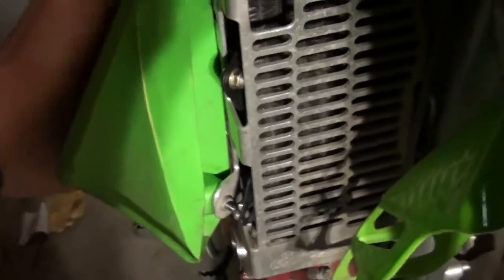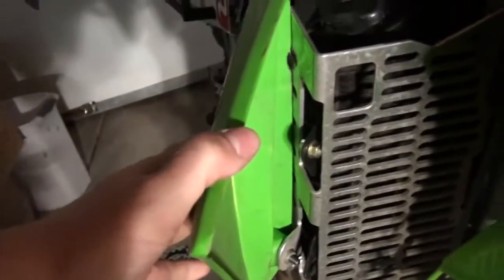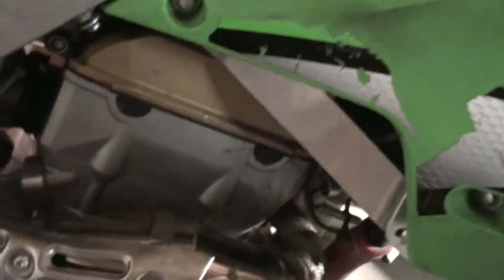You can see that it mounts directly into the shroud, or replaces the bolt that would normally be right here. They do take a bit of work to get the radiators on because you have to move the ground cable that would go on the radiator. But they fit nice — very solid units. They do prevent any shifting and any potential damage you might have to your radiator, making it very unlikely that rocks will go and bend up the radiator fins and reduce your cooling capacity.